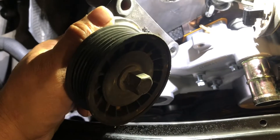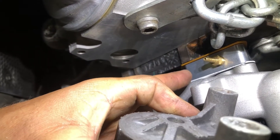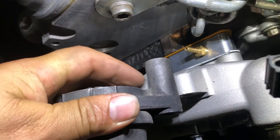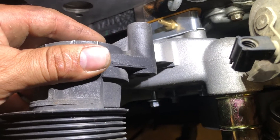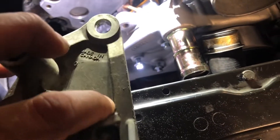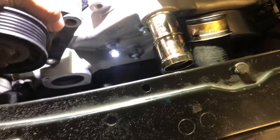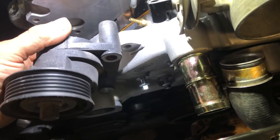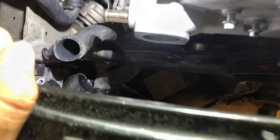Next, I'm gonna have to mess with the tensioner. I used seven-eighths inch spacers which brought out the water pump front, so now I'm gonna take seven-eighths off of the tensioner to bring the belt back to where it needs to be. I'm gonna have to cut up this and cut the triangle off of it, just leaving the two mounting holes, and put it somewhere around there so we can use the factory belt tensioner.